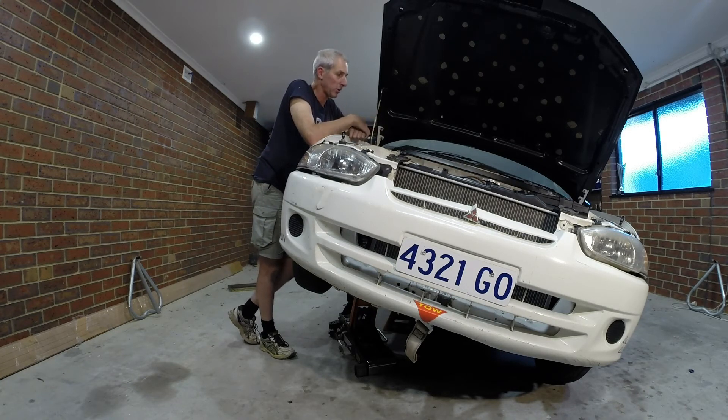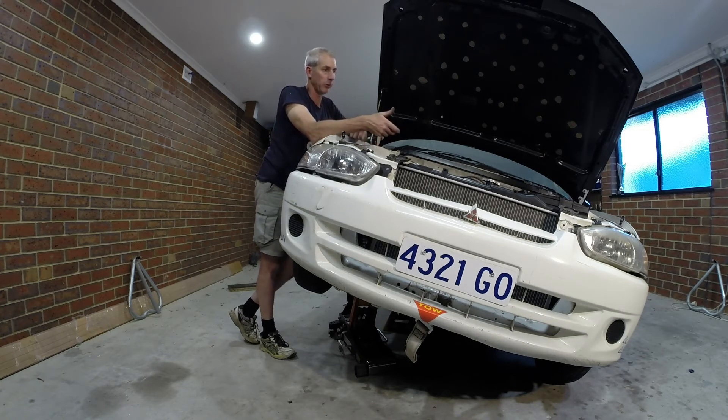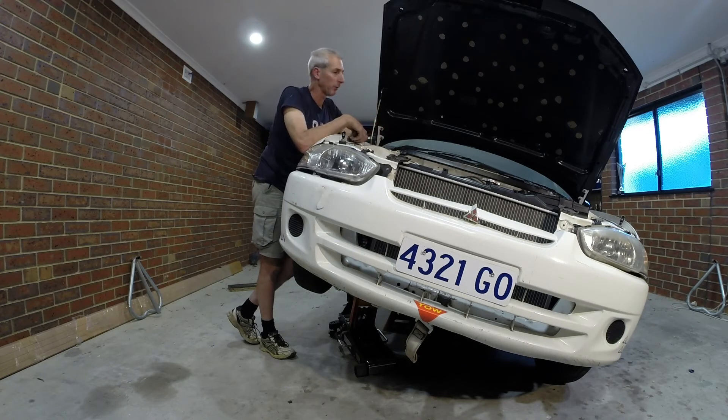There's nothing that I can actually measure here. There may be an application where the pressure from the vehicle is pushing the inside, pushing the lower arms, and the top may be flexing - that's really hard to tell at this point in time. But 3mm top and bottom in both cases are extending outwards under this sort of application.